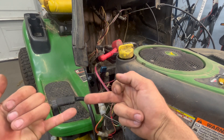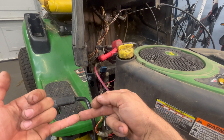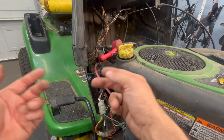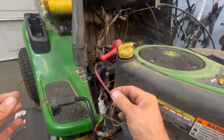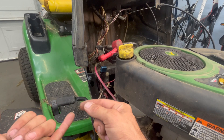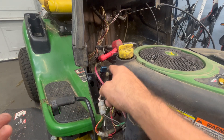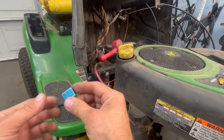If you've got a handful of wires in that pigtail, unplug it and touch one set of wires together with a paper clip or something, then go to the next set of wires. When it starts clicking again, that means you've tripped the fuse and current is flowing through it — that's going to be the wire your problem is on. It could be a bare spot or a shorted component. These resettable breakers are about 8 to 10 bucks at O'Reilly's or NAPA.